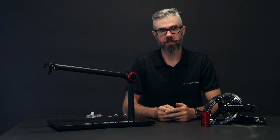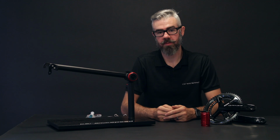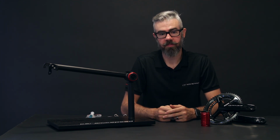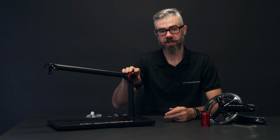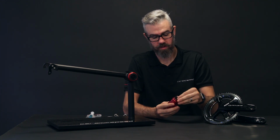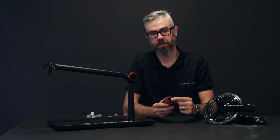Hi, I'm Paul Sullenberger. In this video, we're going to cover the Shimano crank installation guidelines for a CeramicSpeed Bottom Bracket. CeramicSpeed Bottom Brackets for a 24mm Shimano crankset are either going to feature a 61805 bearing as a 25mm ID and an integrated dust cover, or a 24mm bearing that'll fit the crank directly through.